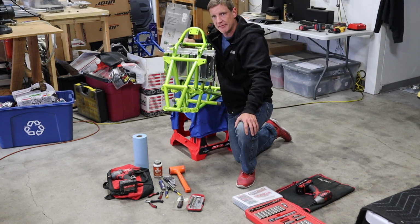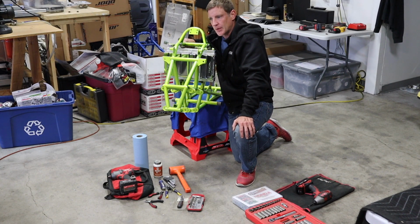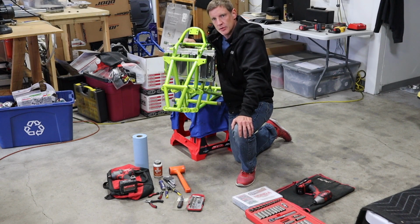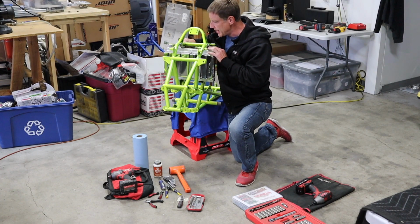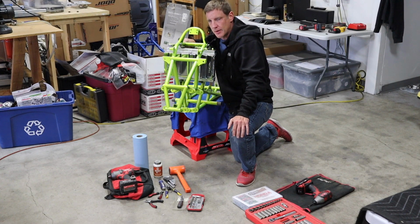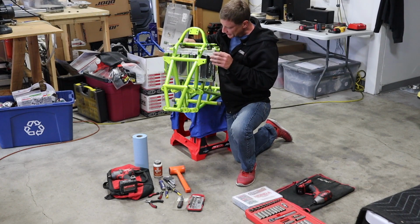My race bike has an AFCO on it. AFCO is a great radiator. CBR, PWR, they're all good radiators. So if you're recreational, you can go with OEM. You can go with one of these eBay guys. I've used these before, never had an issue. But for these, now that I'm running a 363, I just want a better radiator. So this will get swapped out.